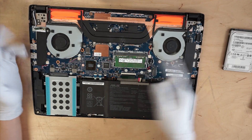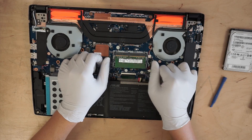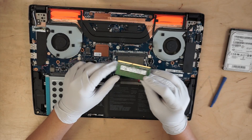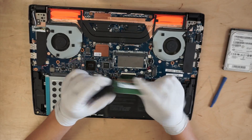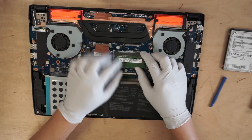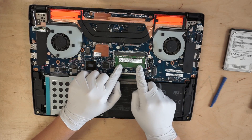Here is the RAM. If you do want to increase to better RAM, this is four gigs. You just have to push on both sides and the RAM pops up. You can replace it with DDR3 RAM — I believe you can go up to about eight gigs. Slide it in and then push it down; the clips will just lock onto the RAM.